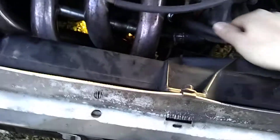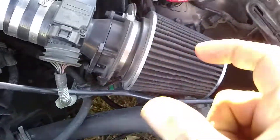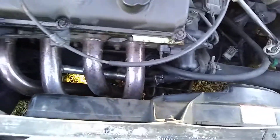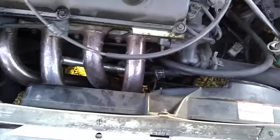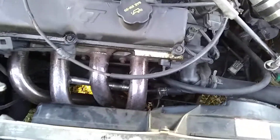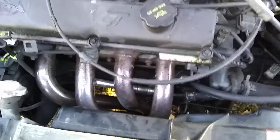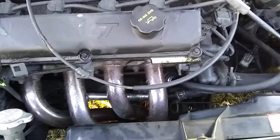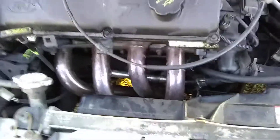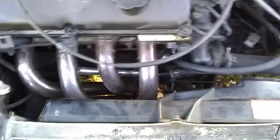You'll find it more on big V8s than on four cylinders. There are little bitty filters — miniaturized versions about yay big — and there are cone filters that some people put on and eliminate the PCV valve altogether. If you're building up your engine with oversized pistons or similar mods, that can actually help, because the PCV valve is designed for stock conditions.